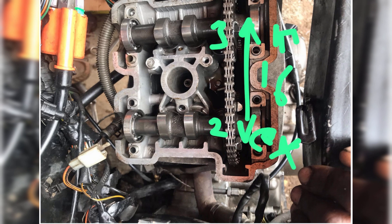A caution: the cam chain must be installed to all three sprockets. Be sure not to turn the crankshaft until the front holder and cam chain tension adjuster are installed completely. After successfully timing the front and rear camshafts, turn the crankshaft 10 times manually. At this time, listen for any noise coming from the engine as a precaution test.